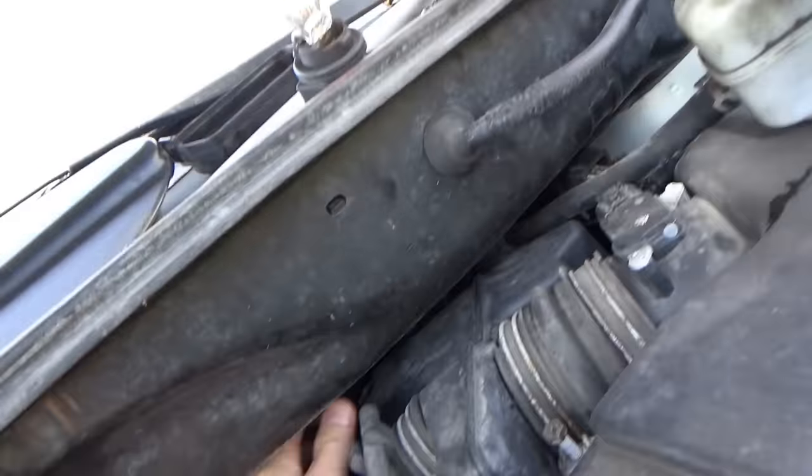So 1.1 amps, I didn't re-zero the amp clamp or anything. All we need to do is unplug the test light and see if the reading changes on the amp clamp. That's all we're interested in, is the change. Look, 0.2, 1.1. That's our 1 amp, so it has to be going to here. This way.